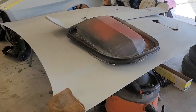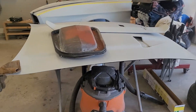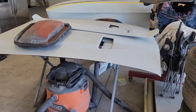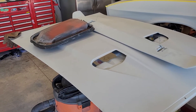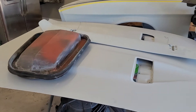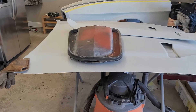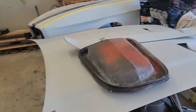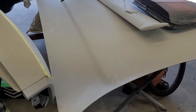So what we got here is my new Mach 1 hood. The EDP coating that comes on these brand new parts is pretty much garbage - all it does is hide the rust. You need to strip all that off and start fresh. Unless you don't care, then do what you want. So it's been stripped and sprayed with Evercoat Super Build.